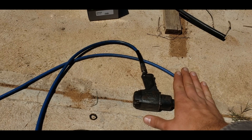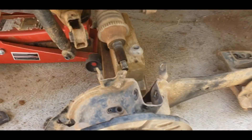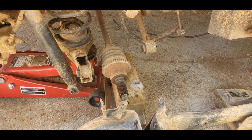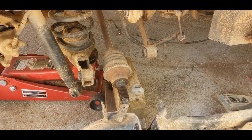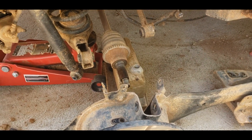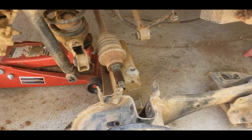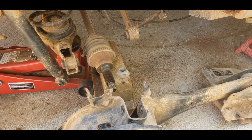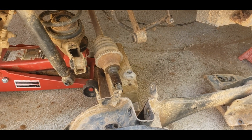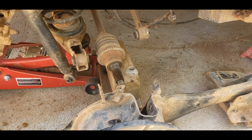Just ignore that — I know you're not supposed to use chrome sockets on an impact but that's what I've got. An impact does help tremendously; that vibration will help break stuff loose and save your hands. Just don't go nuts with it when you're tightening stuff back down because it's really easy to over-tighten certain things with an impact. It's not that they put out a lot of torque — it's just all that vibration seats fasteners a lot better, and sometimes the next guy won't be able to impact them back off.